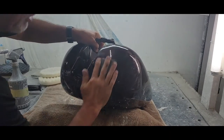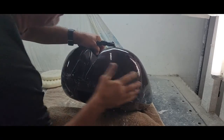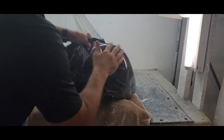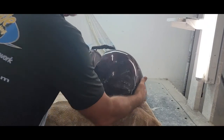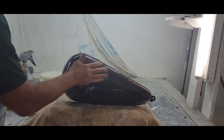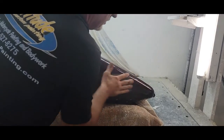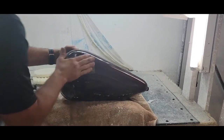The reason I do the bottom first is because right now it's probably leaving prints on the top side — they'll be very minor, but no sense in doing the top first and then flipping it upside down and having prints, and then having to re-wet sand it anyway. We've had this buffing bench for about 20 years now, so it's worked out real good for us. I've got a four-by-four underneath here so it gives me just a slight tilt.